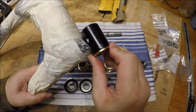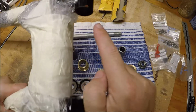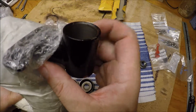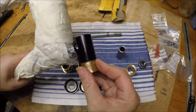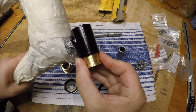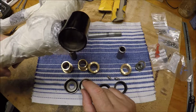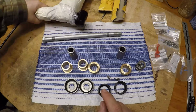Nice. Right then. So, dress this surface here. A couple of bits of chipping that I think I might sand down and put a bit of spray coat on just to stop any issues there. Dress the inside, and then fit these so they don't all slide in. I mean, that's quite a tight slide in. For all the other ones, he went a little bit larger just to have a little bit of a press fit into there. But we'll get those fitted. So let's get these cleaned out. Let's get the bushings fitted.